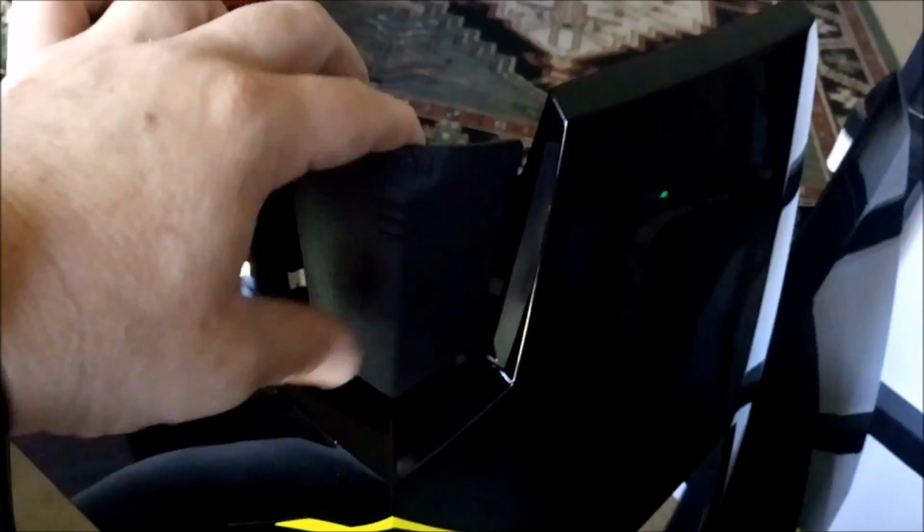Right, so getting this lever back in is pretty much the same way as getting it out. You can see I've got that one in. It's just levering it down through. I'm trying to get some good pictures if I can. The camera's a little blurry, but it's just down in here. Just lever those little tabs out. This will be really nice. You can see them there. Just lever them out to the side, and at the same time push, and it goes click. So again, be careful not to break those tabs.